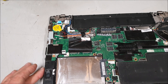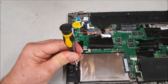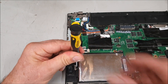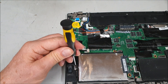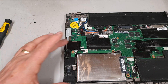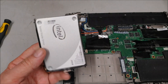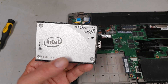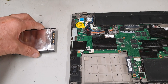Taking the hard drive out — you have a screw at the front, so undo that. It should just lift up and pull forward — it's that simple. This has already got a solid state drive in it, but I want to increase it to 500 gig. This is why it makes them so fast. That's how to replace the solid state drive.